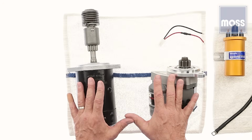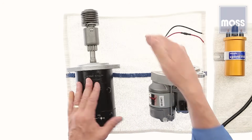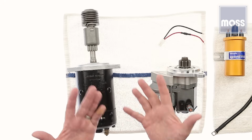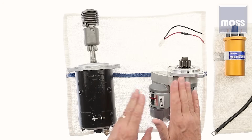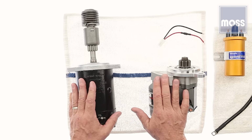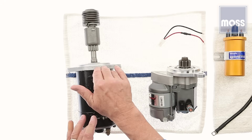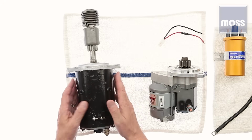We all know that when driving, we can get more zoom if we shift the transmission to a lower gear. We call this downshifting. The motor spins faster, we get more power. Applying the downshift concept to starter motors became popular in the 1960s. Instead of having the starter motor mesh directly with the flywheel, a set of reduction gears were placed inside the starter. Let me show you.